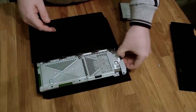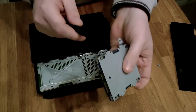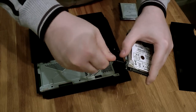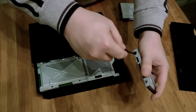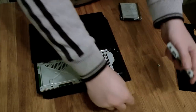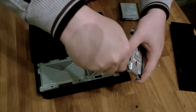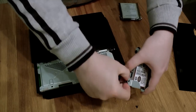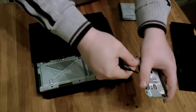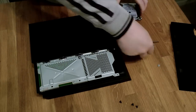You're looking for the little lip — just pull that out and the hard disk comes out with it. The hard disk will have four little black screws, and we have to get those out. Probably not a wise thing to do this over the chassis of your PlayStation 4 in case one of those screws falls and disappears — nobody ever accused me of having too much common sense. Last one there, and it's done.